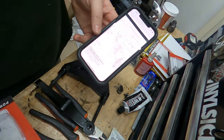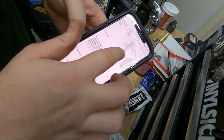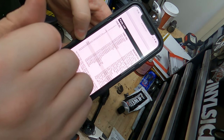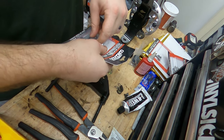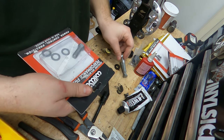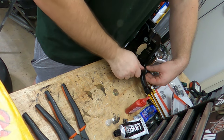Per your diagram, item number two goes on to the caliper bracket, and BM number two is the point-0-16 thickness shim. You also need this hardware. The way this orients: your caliper goes to the rear and your steering goes to the front. I am talking about a Mustang 2 style suspension. Go through — there we go. And then start the threads.